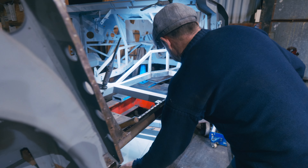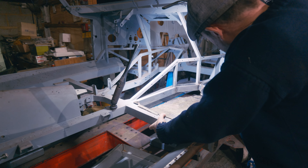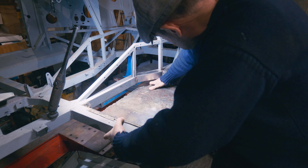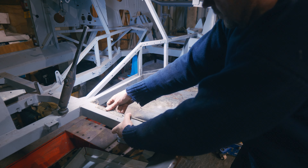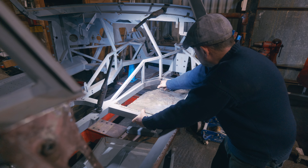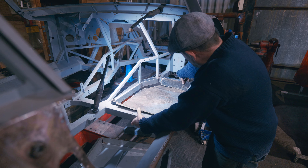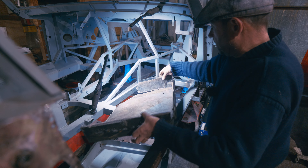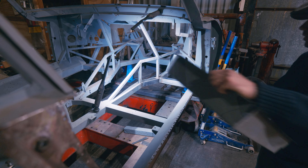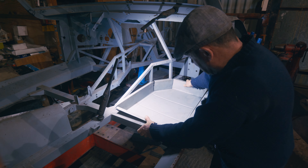Let's start with the factory one. You can see what I mean - it all sits down here like this. So it sort of sits in there and bonds in around here - it's all missing around there because it was all broken up when we took it out. That's why I have to take these out, because dirt gets trapped up in there travelling up underneath. I don't think it's a very good way of doing things, which is why I make them in steel. Welding them in will stiffen the chassis up a bit too, though they're pretty stiff already.